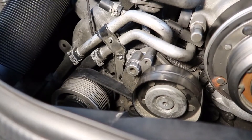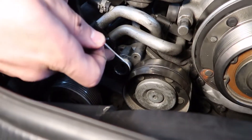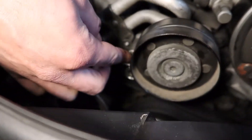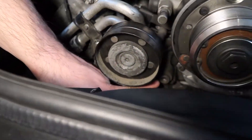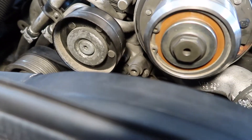I'm going to give you guys a little life hack here. We're going to use one of these little Allen wrenches right here. What I'm going to do is pull back on this tensioner and slide it right in where that groove is, all the way through, to lock the tensioner in place so you have access to that bolt that's right on the back side. It's not too hard to get to now.